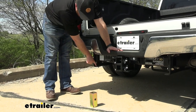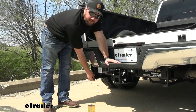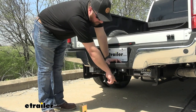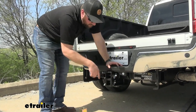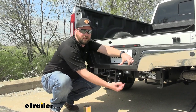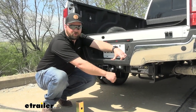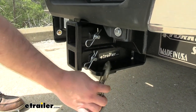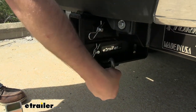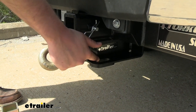Another thing to point out is that you're going to have these extra loops here — when you're using it with the super truss you'll have tie-down chains that help stabilize the truss, and those connect into here and on the other side. The safety chain loops are going to be much easier to connect to than the factory forward ones. A lot of factory ones — in fact the one we took off — had shackles mounted permanently in the hitch itself because the safety chain loops are really hard to get any hook in. These you're not going to have that problem. Here's a standard chain that most people have on their trailers; the S-hook is a bit small for a trailer you'd typically tow with this truck, but if you had shackles on your old hitch you can just transfer them over.